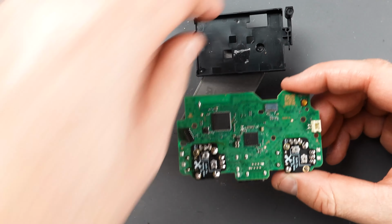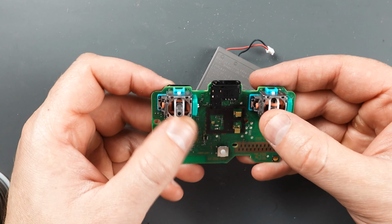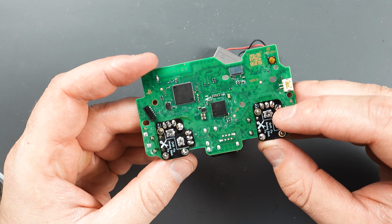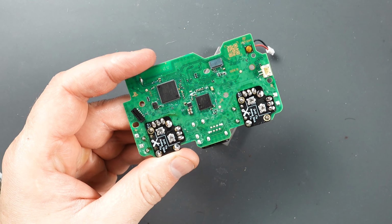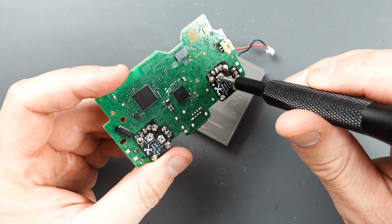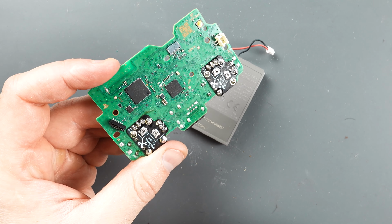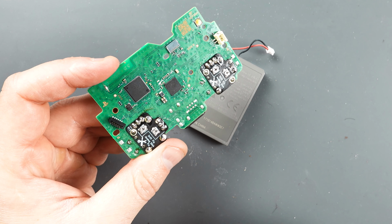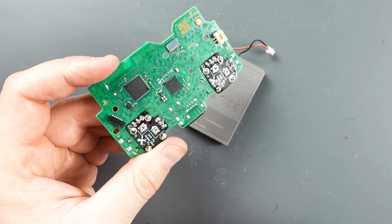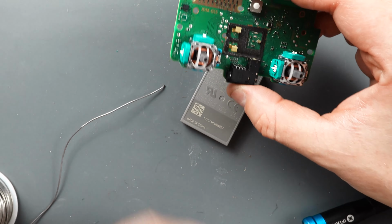The cool thing about installing these is if the controllers ever come off center again, you can take it back apart and recalibrate it. What you want to do is take your screwdriver and apply it to each one of these pots here and adjust them until the stick goes to the center on the application to test your controller, which I'll have linked in the description. So I'm going to go ahead and hook this back up to my computer, and that's what I'm going to do.